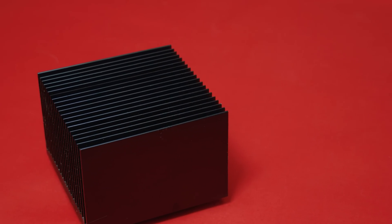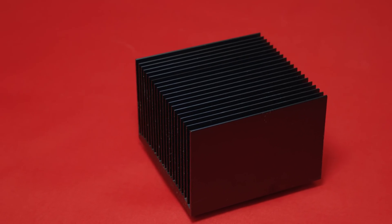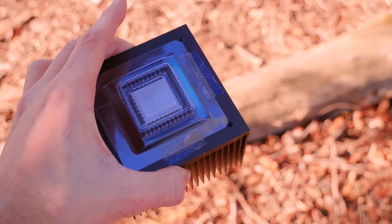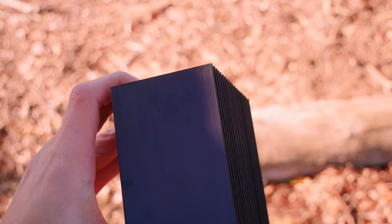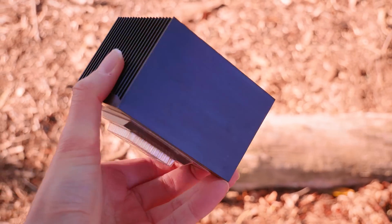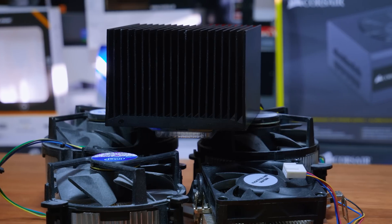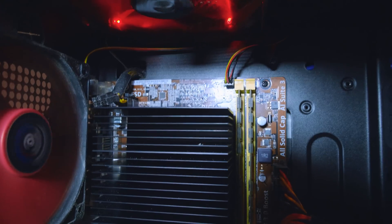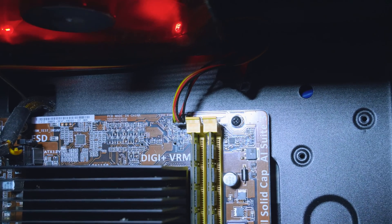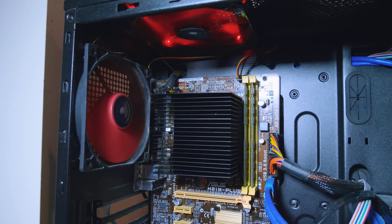In today's performance testing, Pentiums and Celerons definitely run well, and even i3s I'd personally have no worries running. Arctic might not be so quick to recommend it for i3s and i5s, but they do work. On the positive side, this cooler is completely silent, requires very minimum maintenance, and looks absolutely awesome. With the rated 47-watt TDP I had no problems keeping Pentiums, Celerons, and even Core i3s cool with decent case airflow.